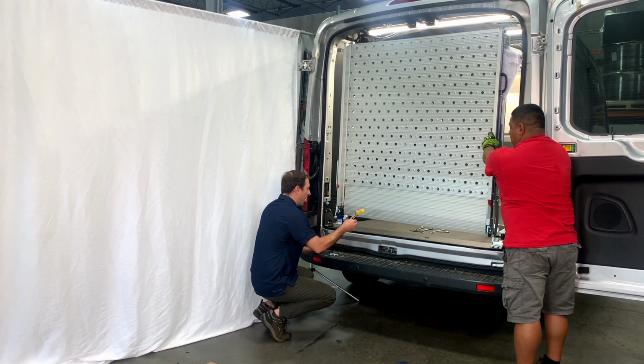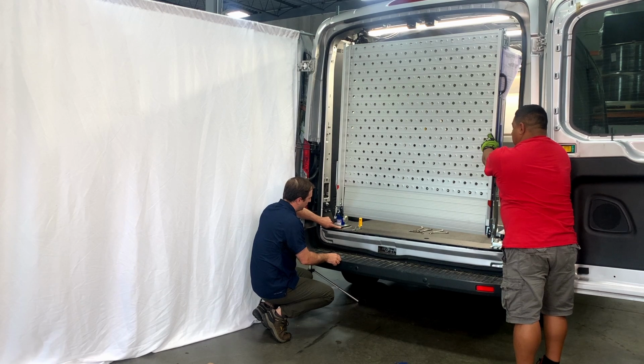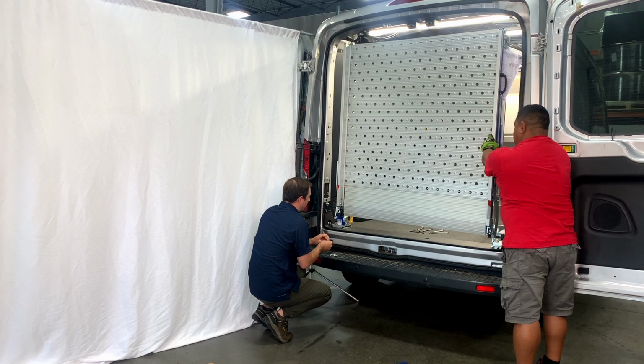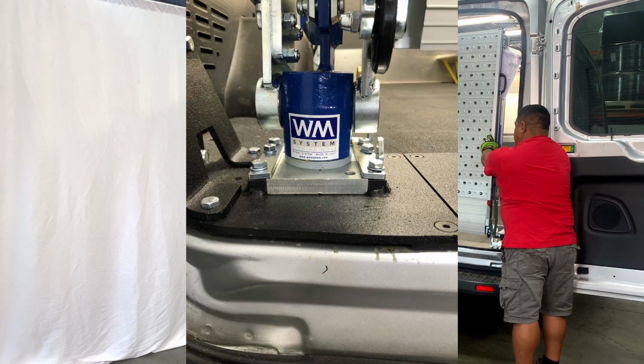We're gonna go back to this nylon bracket. We're gonna place this into position. And you'll notice the foot of the shoe has been flushed right up here at the end of our steel blocks. And the same thing is going to happen with this little finger plate. We're going to take our bolts with the washers. You'll have 3 on each side to complete. Go ahead and loosely, by hand, get these in.